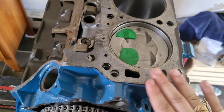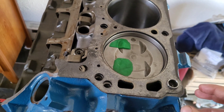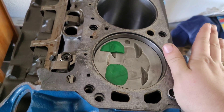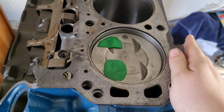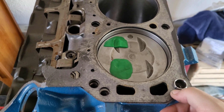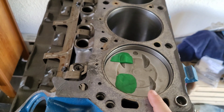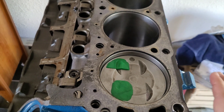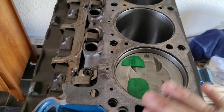This is an old head gasket I used. It measured out to 60 thousandths. I used 1.6 rockers and the clearance was about 140 thousandths. I figure I can use a 40 thousandths thickness head gasket and still be safe - possibly with 1.7 rockers, which adds an extra 30 thousandths. Factoring all that together, I should still be left with around 90 thousandths clearance on the intake - perfectly fine.